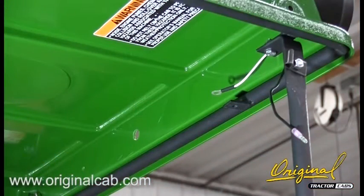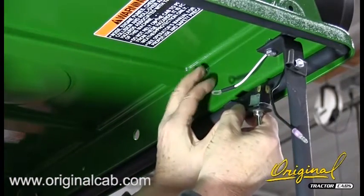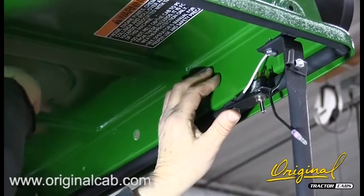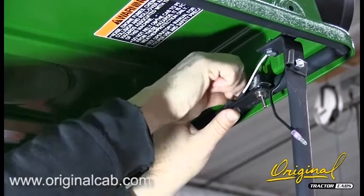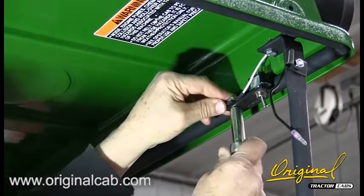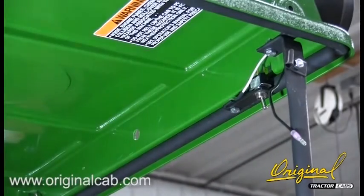Step 3. See figures 3A and 3B. Install the switch and secure the light. Install the light switch into the large hole in the switch bracket. Attach the bracket to either the right or left tab on the top frame. Place the small ring terminal of the white ground wire over the bolt and add a nut. Run the white ground wire to the hole in the gusset for larger 40,000 series tops. Tighten all bolts at this time.